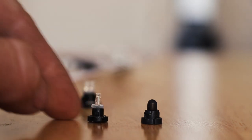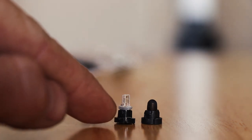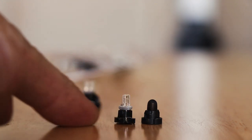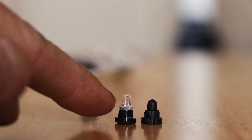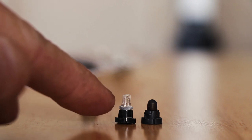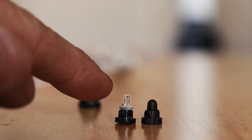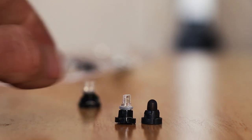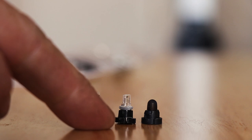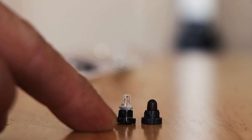The main thing I noticed when installing these bulbs is they lock into place pretty snug. The main difference is they don't just drop straight in like the factory bulbs do - there's a white ring under the LED portion that you have to orientate just right to get the bulb socket to drop into position. Then you use a very small flathead screwdriver to turn the bulb and lock it. Type A is for all your buttons - volume controls, cruise, hazard switches - and type B is for your AC controls.